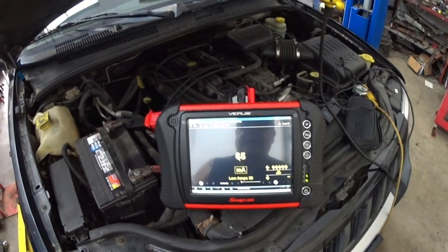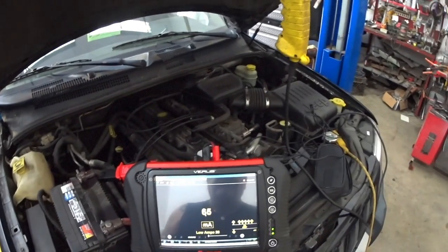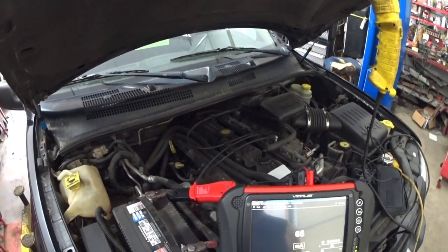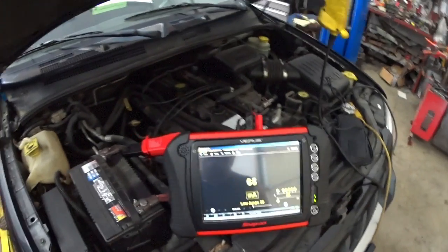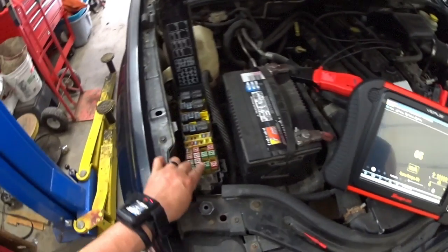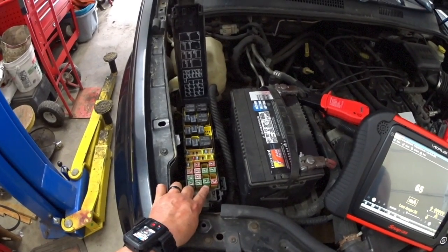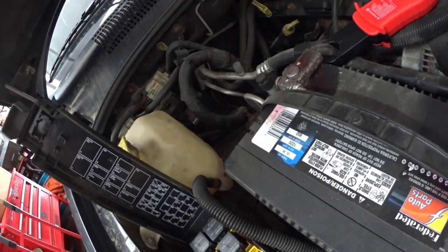This is what I always check when I look at cars — I check if something is aftermarket. I was told by Pete at Pete's Garage that he installed a remote starter in this car. And that is what is drawing the 15 milliamps over the threshold. I just found it here — I disconnect this fuse, it's a 40 amp, and that is for the ignition starter.